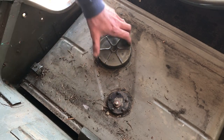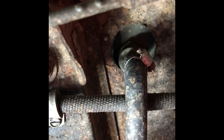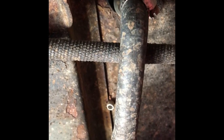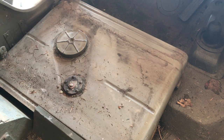Now comes the fun part. We get underneath and we're going to have to undo the fuel line to get the little remnants of fuel left in that tank. So we're underneath the Jeep now, and if you look right there, that's where the actual fuel line comes through the tub floor. Someone has put an inline filter in here, which is a good idea. You can see pieces of the old one that they just cut off and left there. I've got a little fuel left in the tank — not much — but I don't want to spill it and cause a fire, so I'm going to remove this and drain that into my gas can.